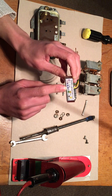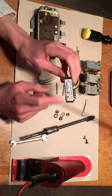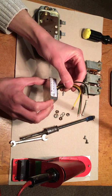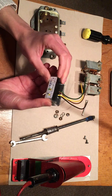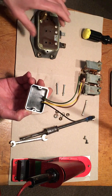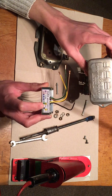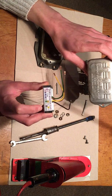That's because my dynamo on the Humber has a maximum output of about 30 amps, and it's negative earth because my car has been converted in the past. The website is electrodynamicsolutions.com. This is just how it arrived - I've got four wires here: the black ones to earth, and these three to the various connections. Brown wire goes to BAT which is B, yellow to D, green to the field terminal F, and black to earth.